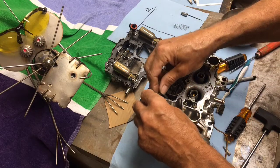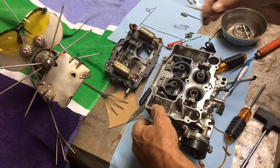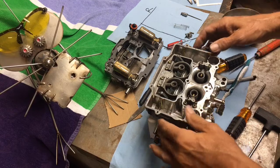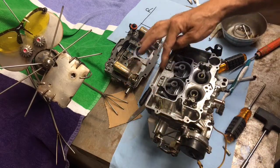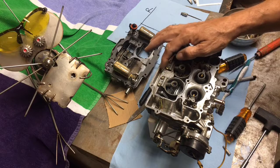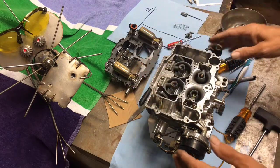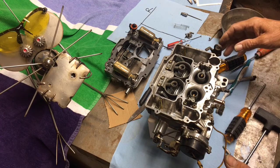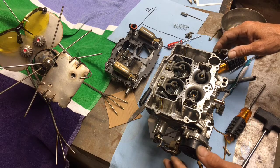Put the baffle back in and push it all the way down so it's lower than the top — more than flush. A nice feature of these carburetors: if a needle or seat plugs up, fuel will cross-flow over to the other side and keep you from flooding.